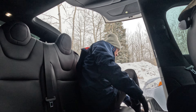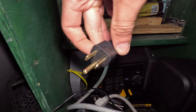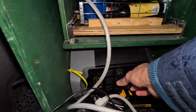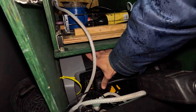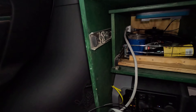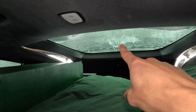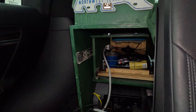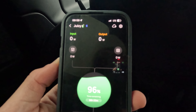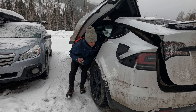First thing — I'm going to unplug all the other outlets, including my fridge. Now we have our handy dandy grounder, which is needed with the mobile adapter, otherwise it detects a fault — this is a safety precaution. Now we plug in the mobile adapter. Some of you suggested I needed more air ventilation down here, so I'm going to open the hatchback and remove the subfloor cover so cold air can come in to cool the battery. We're also going to lower the amperage. Still getting zero watts of solar input — I think it's because the cloud cover is too thick with the snow.